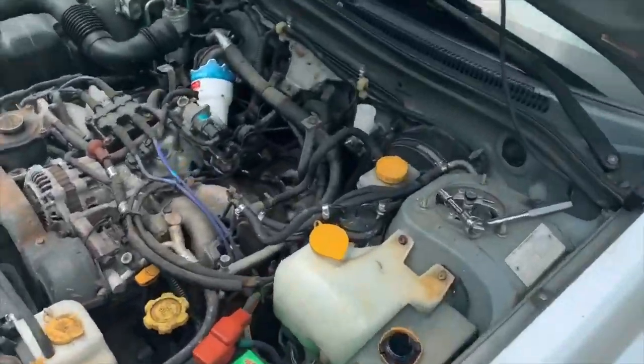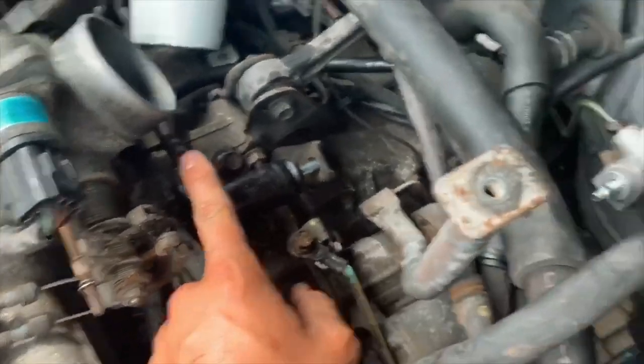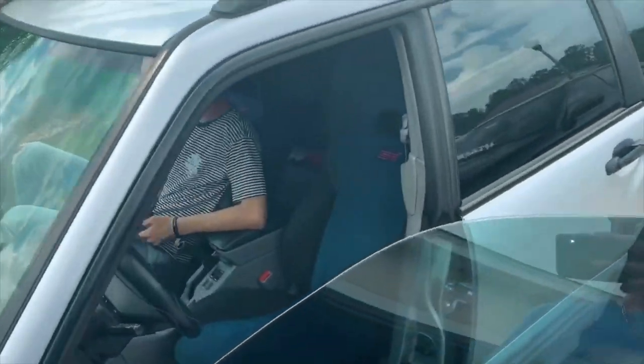Both are installed - put the slave in, tighten the two 14s, tighten that, and those were the two bolts I showed you guys already. I'm going to put brake fluid in and then my buddy is probably going to help me bleed the clutch real quick - make sure there's full travel when you push it down and up. Then we'll take it around real quick to make sure the clutch feels good. Pretty simple install - just put the airbox back on, make sure it's bled, and that's it.